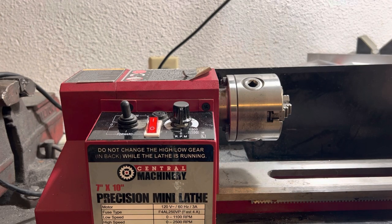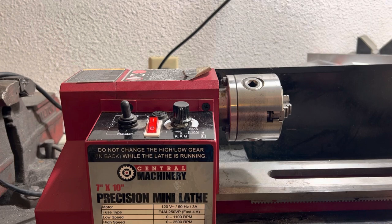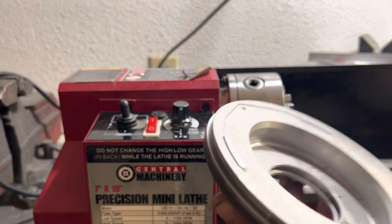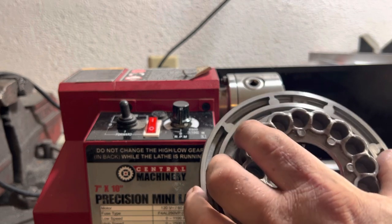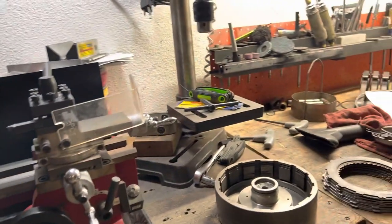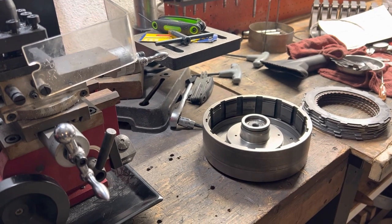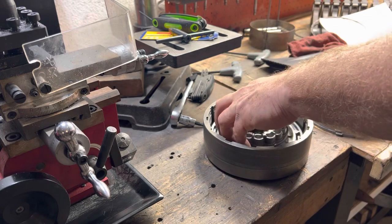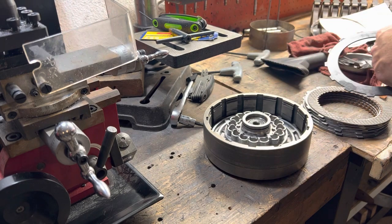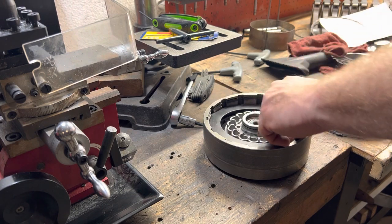This is my forward apply piston — it does not have a check valve. You can see there's a little spot where there could be one but the factory didn't drill it all the way through and put a check ball in there. Let's move over to the forward drum. You don't need any seals on here just to do your measuring — drop the piston in and start loading your clutch stack. Once you get it going they go pretty good.